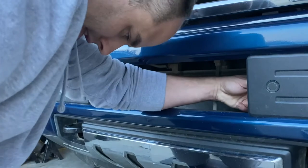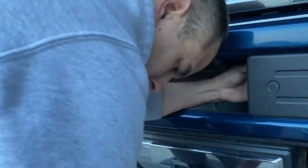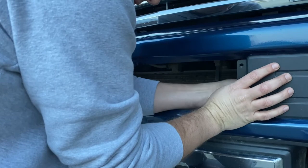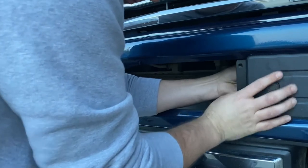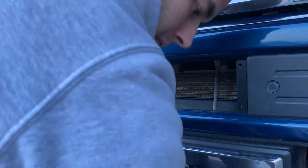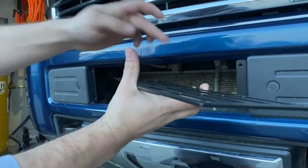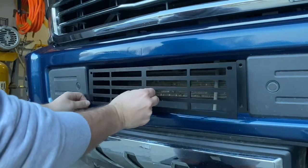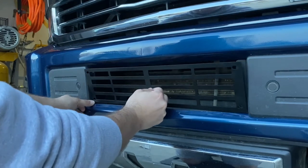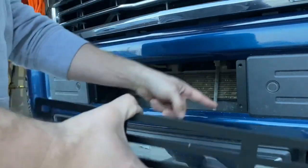The stainless bolts are 7/16ths, and the finish bolts — the button head bolts for the grille — use 4mm Allen wrenches. Just get them snug. It doesn't say what's front or back on this, but it does have a little bit of a curve to it, so this must be the back side. Just seeing if the holes line up pretty decent before I crank down the brackets. Looks pretty good. I don't think you're supposed to put any more of a bend on this, but it could probably use it just to follow the line of the bumper a little better.